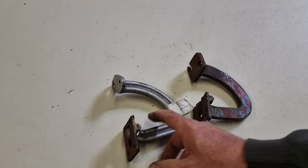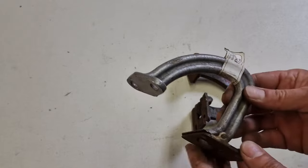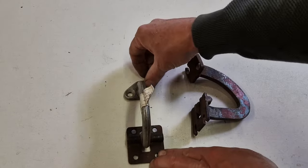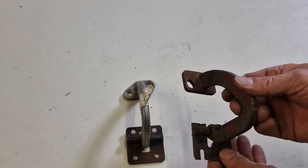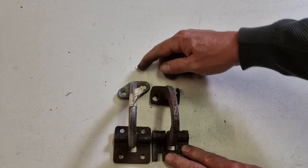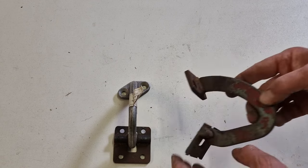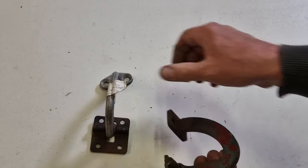And here's another thing. This is a genuine Jaguar part. This is a tailgate hinge for later cars, introduced in May 62. And this, as you can see, is a bit different to this one. This is often from a very early car, and they had these hinges. They had different positions, they were mounted differently, and you see here this only has 2, but it should also have had 4. But you need to have this kind of shape. It is very similar, but it looks terrible.